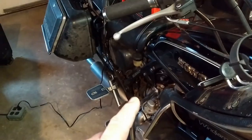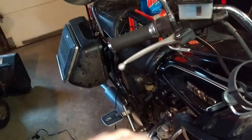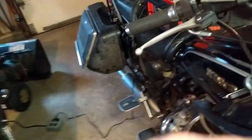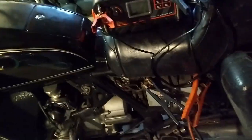The fuel tank — we looked in there as soon as we got home last night — it's pretty clean. I'm going to throw some Seafoam in there, let it sit for a few days, empty it out, rinse it with some used gas I've got, and see if it comes back. It really should. There are a couple of hoses off, but as far as I can tell they're crankcase ventilation hoses that probably just worked loose. All the hoses are there — I just need to reconnect them.